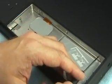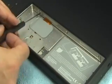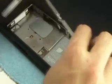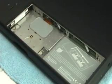If you don't own a Phillips P0 screwdriver, NewerTech makes a seven-piece Apple tool kit that includes all the screwdrivers you'll need shown here today to remove the memory and the hard drive. All you have to do is unscrew those screws and gently pull on the screw heads, and you'll take out that L-shaped bracket, exposing the two memory bays. Over here on the left side you'll see that's where the hard drive is.